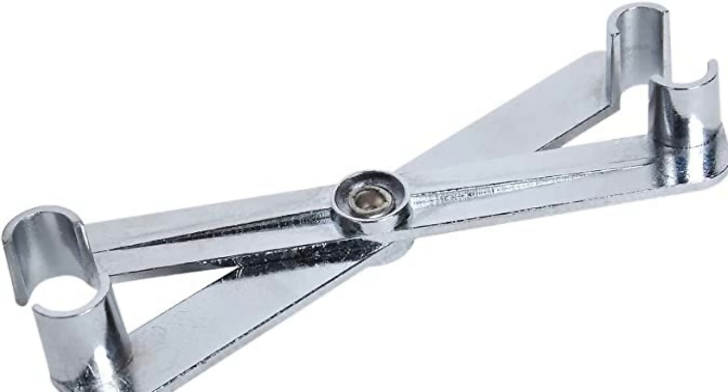Here's the thing. The newest of these cars is going on 20 years old now. And there are several things that you can attack while replacing this, doing it the correct way. So I'm going to kind of walk you through what you need and how to proceed as you go ahead and replace this sensor. You're going to need a gas line tool. It basically looks like a little X. Here's a picture of it right here. You basically press it into the little rubber donut where the fuel line's coming into the fuel rail, and that'll pop that loose. It'll automatically shut itself. You shouldn't have any leakage or anything like that.